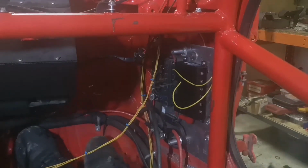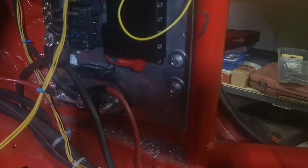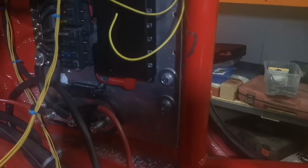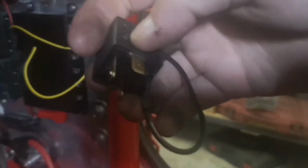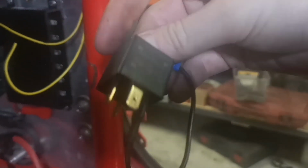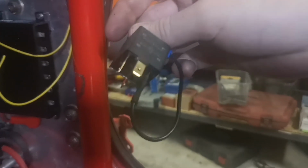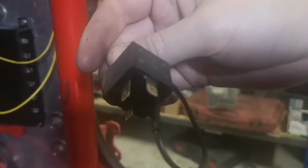So we're going to attach 2 of the relays again. There's a nice spot right there below the PDM to attach them. And there I can also ground the outputs from the relays, so that you have the trigger on this one, and it's just grounded, and then you have fuse pad or 12 volts supply voltage into one of the 2 other pins and output again.